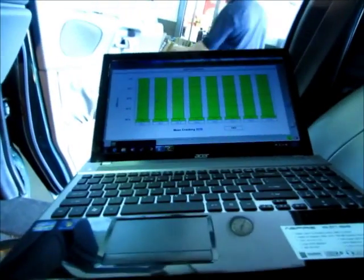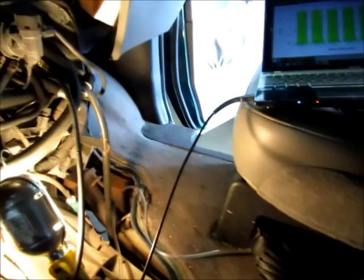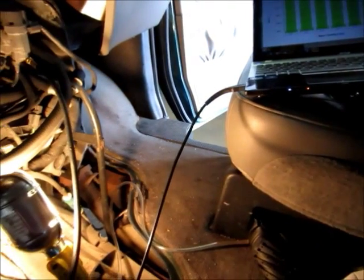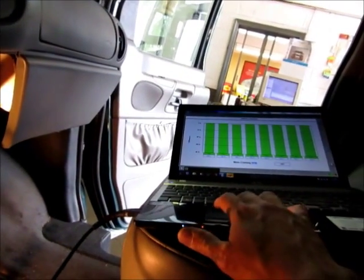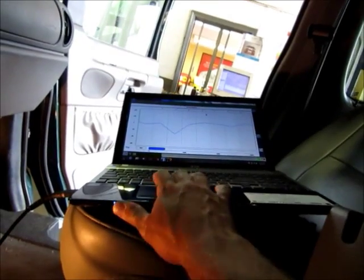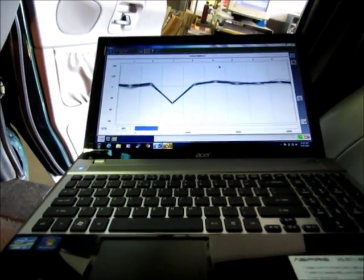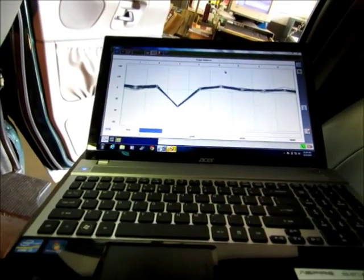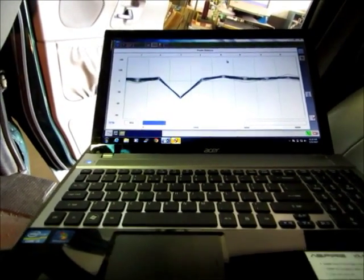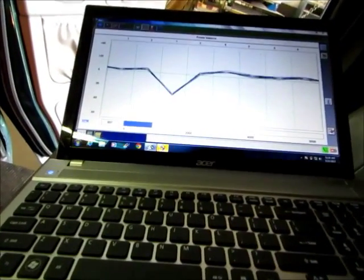Did a relative compression check on this vehicle. However, if we go to a power balance test — as this refreshes — you'll see cylinder number 7 has got a dead miss. Over and over again, cylinder number 7 is the problem child there. We refresh that and erase it. Number 7 is goofing off here.